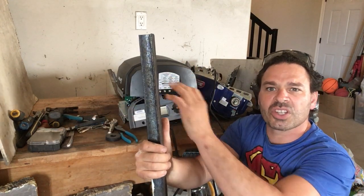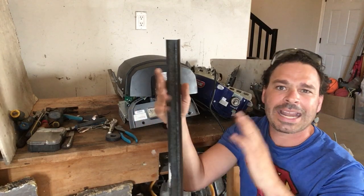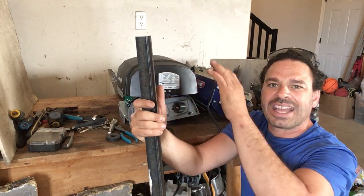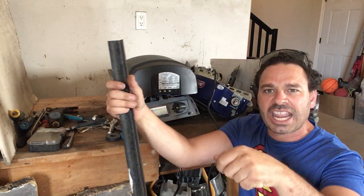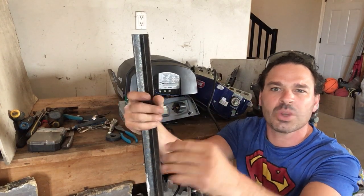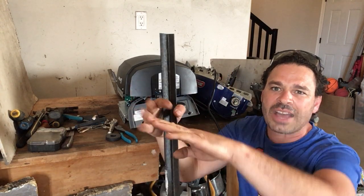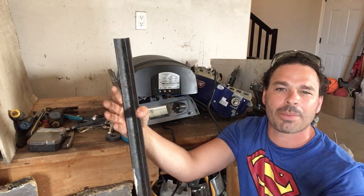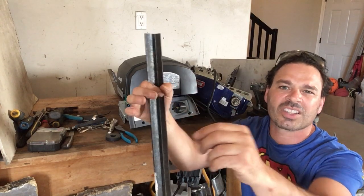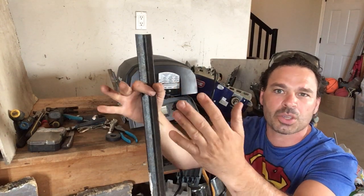The other models did also contain the chain as well as the pull cord and handle — all of that was scrappable material. I do want to point out safety concerns: if you find a garage door opener that is still intact with the track and the chain, please do not just go ahead and cut the chain with a grinder or hacksaw. That contains a tremendous amount of pressure and tension — that chain would fly out and possibly hit you or someone else. There is a nut you just have to loosen; it will release the tension, and once that tension is gone you can proceed to cut it or pull it off the track.